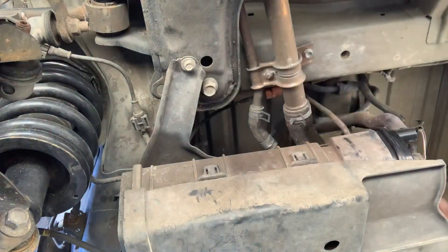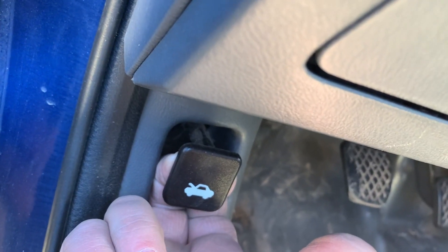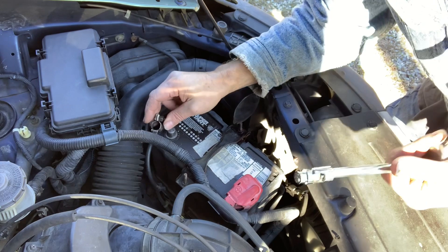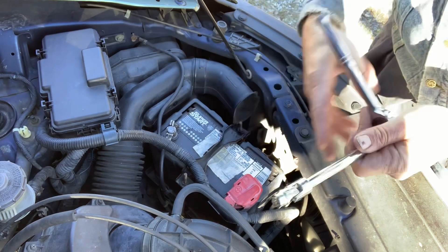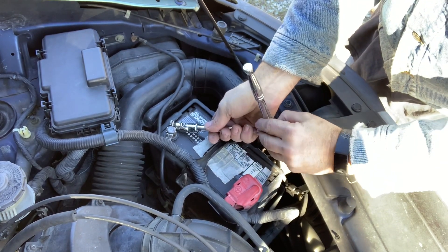That's it — no more tricky than that. Always pop the hood by putting your fingers behind this tab and pulling straight out on it. It is not hinged and it will not flip up — you will break it if you try. To clear the check engine light, we unhook the negative battery terminal for a minute, hook it back up, and that will clear your check engine light codes. Then we watch to see if it comes back on — the battery terminal is a 10-millimeter.